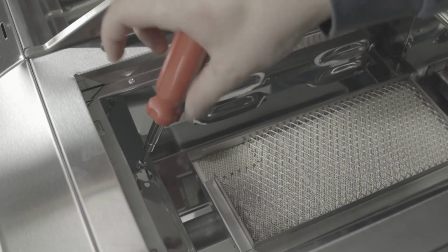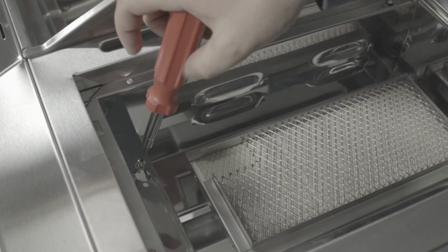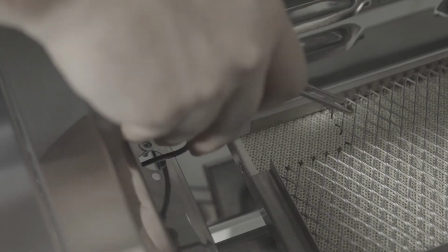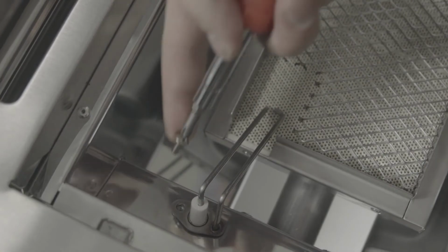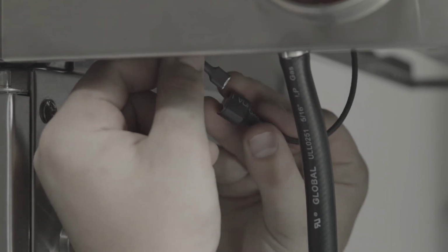Next, locate the pre-assembled screw on the inside of the searing side burner bowl assembly, closest to the control panel. Remove the screw, insert the sear burner igniter wire through the vacant hole, like so, then reinstall the screw. Once secure, plug in the wire from underneath the assembly.